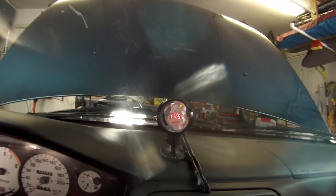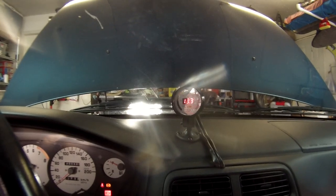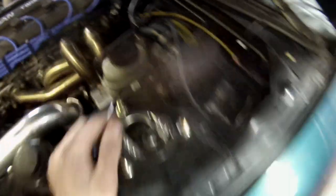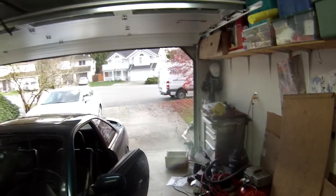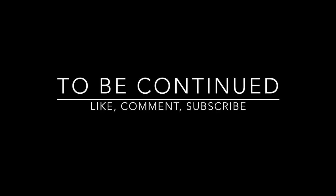That seems good. As soon as I give it any gas it's dropping down though. I'm going to go for a little drive — I've got the wideband running under the hood through the window for now. It's too close to the turbo but hopefully it'll read alright. I just want to make sure the car will run and get me to my friend's house. I won't be boosting or doing anything crazy. I'll update you guys when I get back.